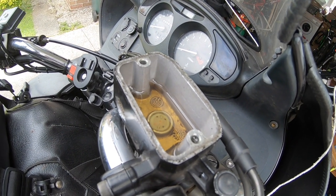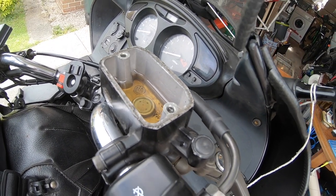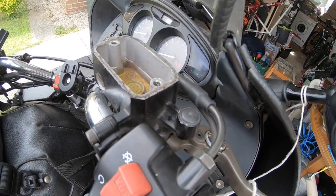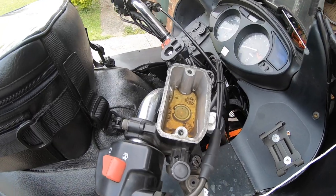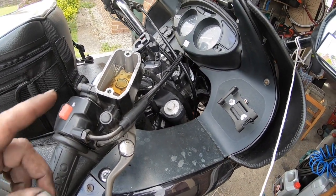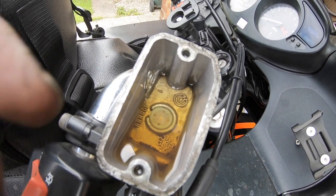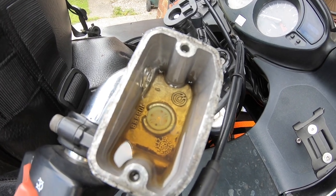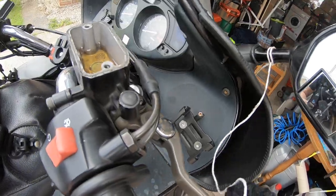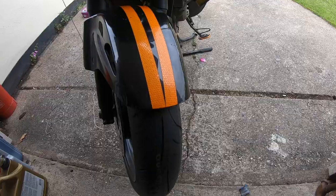So when you push the pistons back in, take the top off the brake fluid reservoir and turn the handlebars to the left, which makes it awkward when you're doing the left side disc, because all that fluid rises up then. If it's full, it'll all be spilling out under your paintwork. So what you have to use is a syringe, hypodermic or something, and pull some of that fluid out. What you don't want is to have it bone dry in there. So I've always got a bit of fluid in there, so now I'm going to have to bleed the brakes as well. Wheel spins all right.